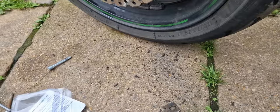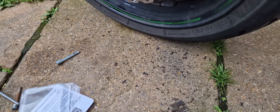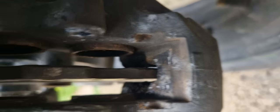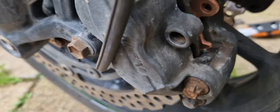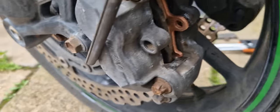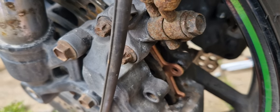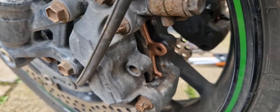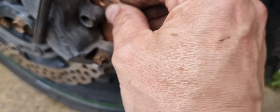I've got my pads - try and undo these with one hand. Just trying to make sure there's just nothing in there that's going to stop me. These pistons - they don't come out that far. I pushed that in by hand, really, and used the back of a pad - nothing crazy. My disc has probably got a millimetre wear on it maybe. This old bike needs stripping apart. The Kawasaki coatings need all taking off and recoating properly, which I will be doing myself shortly.